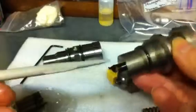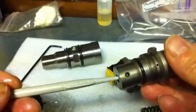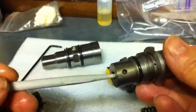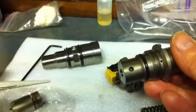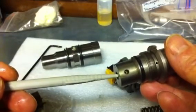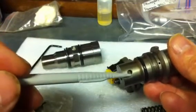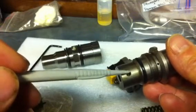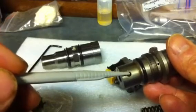That's at the plunger at its maximum stroke. Now normally, this would only go up to about this spill port or bleed port. If you went further past it, obviously as the plunger comes down it's going to squeeze fuel out there instead of squeezing it this way into the injector. So that's just something to keep in mind when and if you want to make your injectors larger. That's why a lot of times this port is plugged with a ball bearing or something of sorts — they pound it in there or some plug, and then they'll crease this area so that it won't come out.